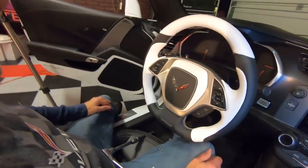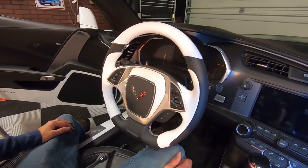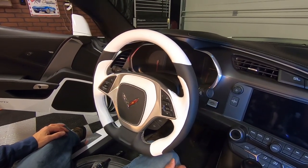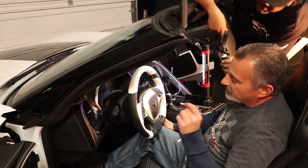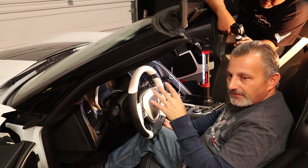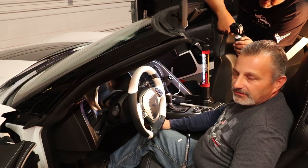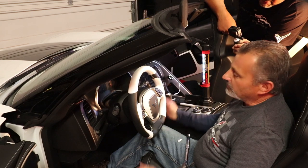So there you have it. This took a lot longer than we expected because of that bolt. I have never seen or heard of a bolt taking that much torque to get loose. I don't think you're going to have that to deal with, but if you do, your biggest trick right off the bat is to use a half-inch impact with a T50 Torx and just hit it — it should just come free. It's just step by step, piece by piece.